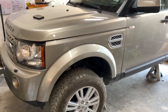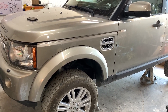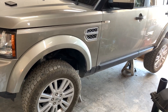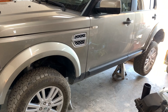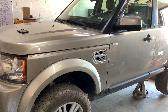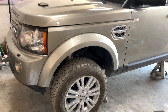After several successful test drives, my daughter's 2011 Land Rover LR4 is running well. Just to recap: we changed all the timing components and chains, tensioners, and guides. Had some issues with the fuel injectors so we ended up replacing all four fuel injectors on the driver's side - I did a separate video on that. Then we ended up replacing the intake camshaft variator on the passenger side, bank one, due to getting an engine timing code. That seems to be fixed now after replacing that. We've had some good test drives, so now we're going to move on to other things that need to be addressed. Thanks for watching, see you on the next one.